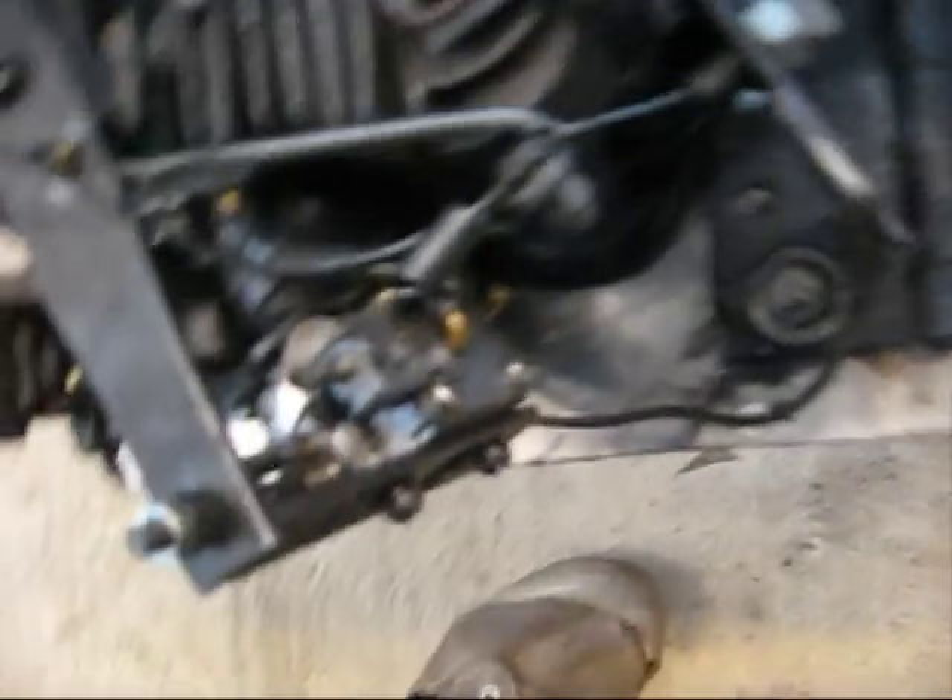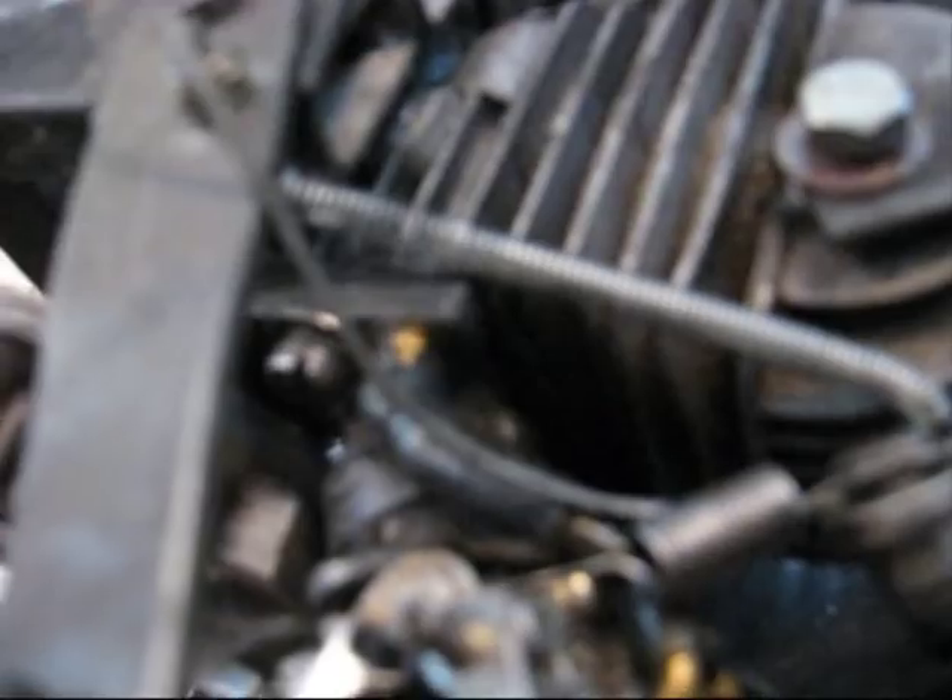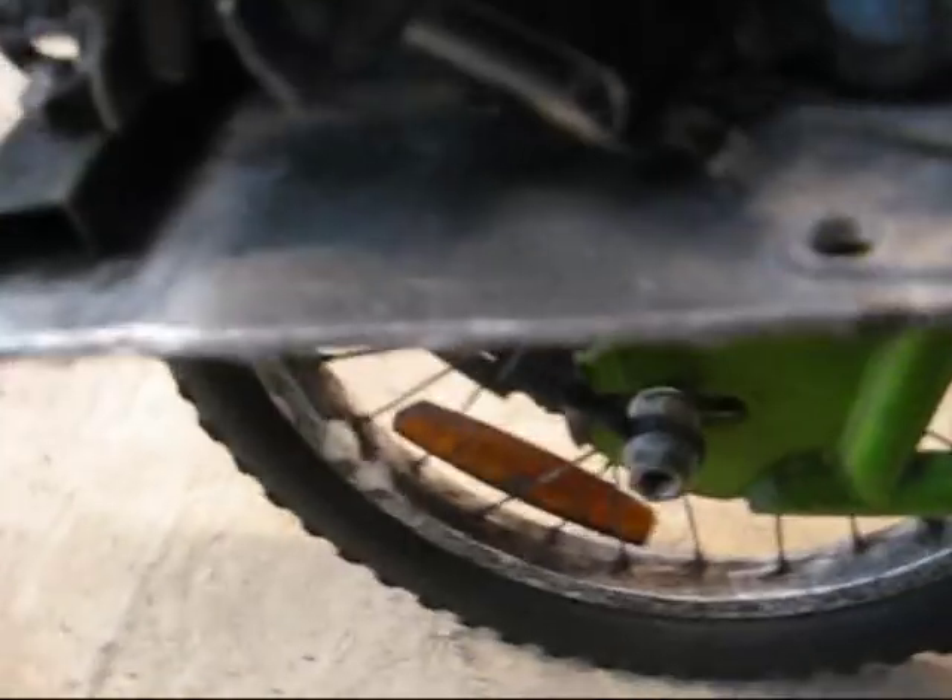The intake manifold was made of plastic, and due to the vibration it cracked. I fixed it three times with super glue, and it broke again and again, so I decided to make a metal one. Also, behind the magneto there's a plastic spacer — that broke too, so I had to make a metal one.